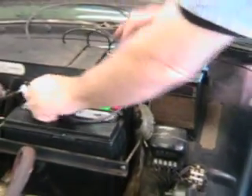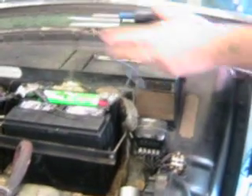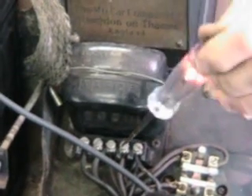I want to show you that you can use your 12-volt test light as the ignition light if you go between the hot side of the battery and D on the control box. So here's our ignition warning light, and if we start our car up, we'll see that the ignition warning light goes out.